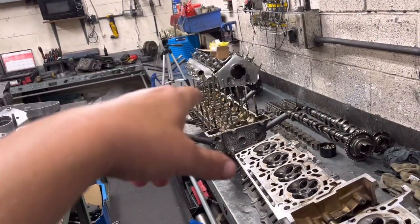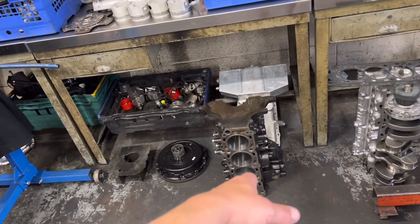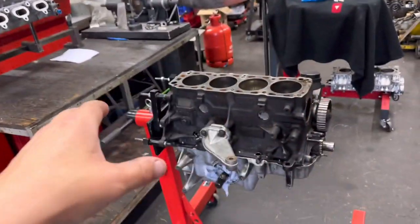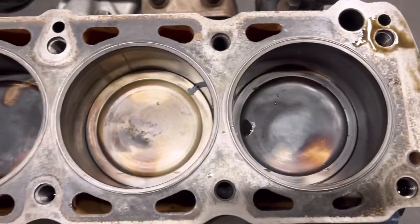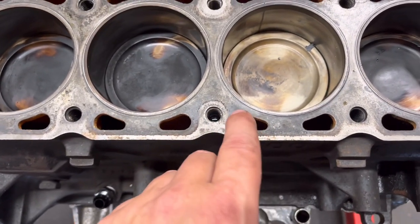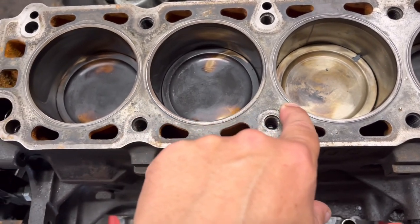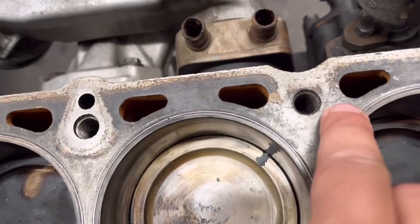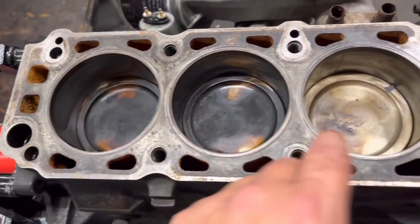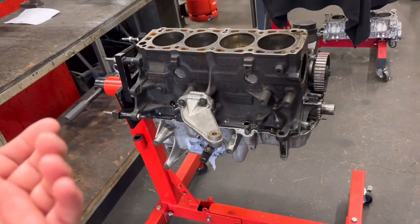You know about my one — can't wait to get in amongst that, might even come in the weekend to tackle that. We've got that Cosworth off the stand because we're still waiting for the liner; as soon as that comes we can get that in. We've used the stand for this one — this is another Cosworth. The cylinder head's up there; I think what's happened is, looking at the face, we've got the rings in so we're going to have to do something about that. We're going to have a chat with him today — whether we put the top hat liners in, that's probably my preference, because he said he wants like 550 horsepower eventually. We're going to get rid of those. The gasket has been blowing quite severely over here and you can see the block is cracked there. That crack I don't think has anything to do with this — this has been blown for quite a while, so this block definitely needed a face anyway, but we're going to long-stud that. We're going to strip it out sometime today, see what we've got inside, see what the crank's like, and then I can give him another phone call.